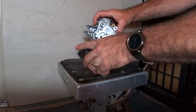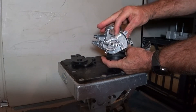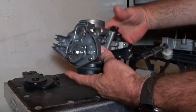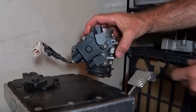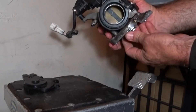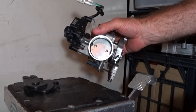This is the throttle body from the 449 model bikes. As viewed from the left side you can see where the throttle cables come in — that's the primary throttle, all fairly standard. You can see up the top here a cam, which is connected on the other side of the bike to an electric secondary throttle butterfly motor. There's another butterfly in the top of the throttle body. The primary butterfly operated by your hand via the cables is normal throttle down the bottom, but the upper one is essentially a fly-by-wire throttle controlled by the computer.